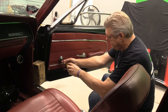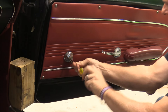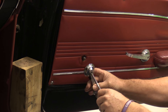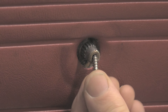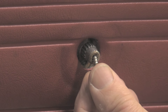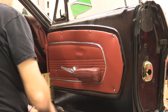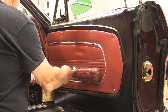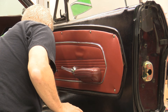I'm going to start taking off stuff. I'm wondering if this one's going to be like the last one I pulled off. That's not supposed to do that, as a guy on Instagram says. This is actually the incorrect screw for this — this should be a machine screw inside here, not a self-tapper. Using self-tappers is not as problematic on the window crank as it is on the door handle, and conveniently they also used a self-tapper on the door handle. This will strip out much quicker than a machine screw, and it's not even deep — it's fairly shallow.